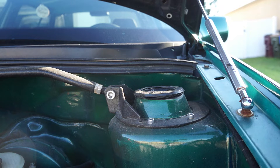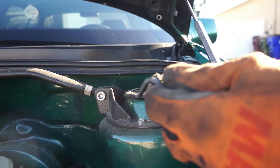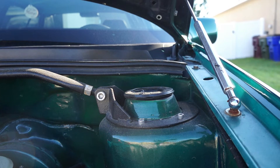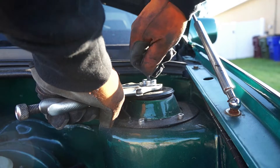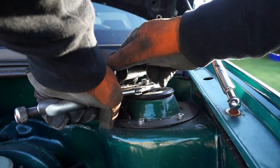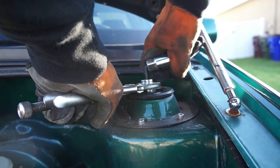Vice grip with your 19mm socket, just going to sit like this. Where's my Allen wrench — 6mm Allen wrench. What you need to do is hold the nut, and since you're holding the nut steady, you need to reverse-thread the strut. So what you need to do is turn it counterclockwise, as if you were loosening it.